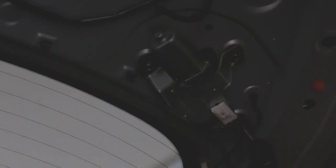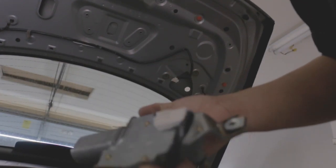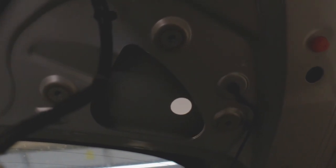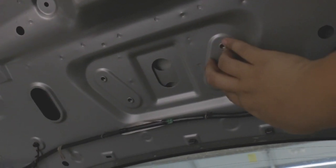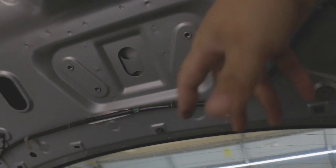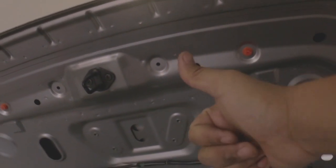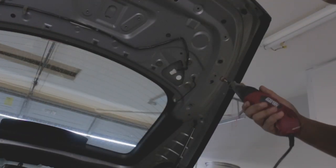Go ahead and take off your 10 millimeter bolts holding the motor in. At this point, since you're deleting it, you really don't need the motor, so you can chuck it or save it — it's up to you. As you can see, there's a hole now. A lot of people just patch it, but I'm going to weld in a piece of sheet metal so it's fully shaved. Apparently there was supposed to be a one or two pound weight bolted here, but the previous owner took it off — weight reduction, check. Now I'm going to take my Dremel and grind away the paint down to bare metal.